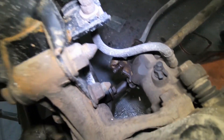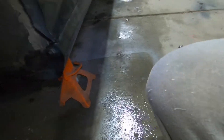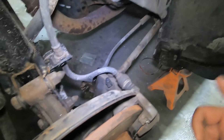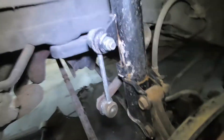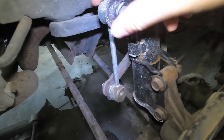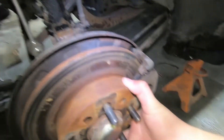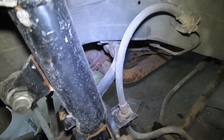As you can tell, it doesn't look great. I've sprayed it with some silicone spray, liquid wrench, yada yada, just to try and break things up, because it doesn't move so well — very resistant. When I pull the e-brake up and put it back down I can tap this thing back a little, so I'm guessing it's kind of getting stuck. The end links I installed before still look good, and I've got better movement out of this now compared to earlier when it was just stuck. I can't find anything screaming out as wrong, and the sway bar bushing is still fine.